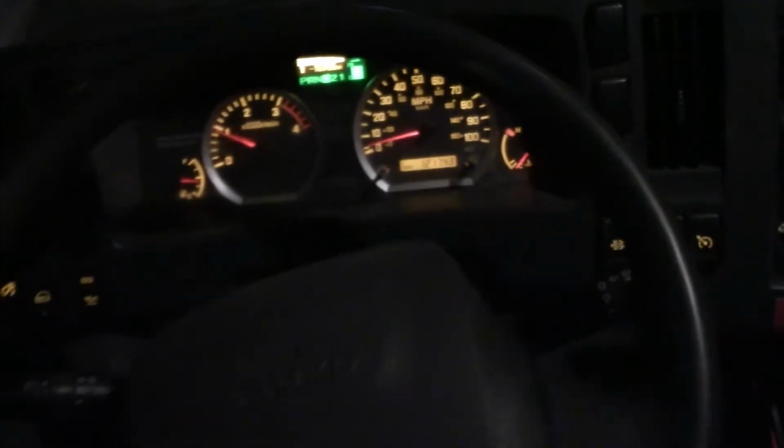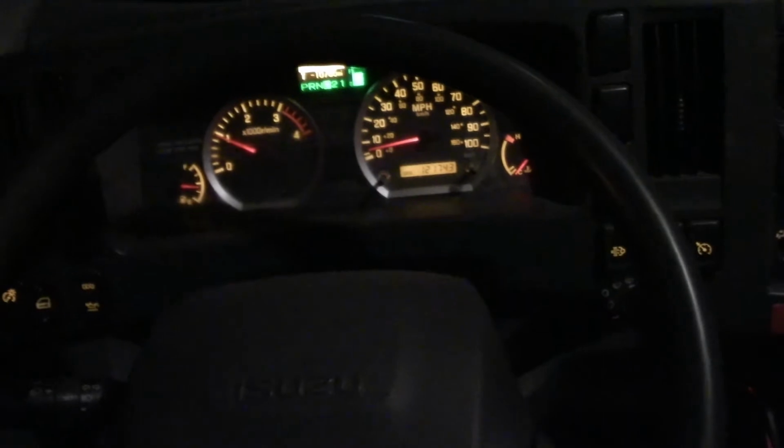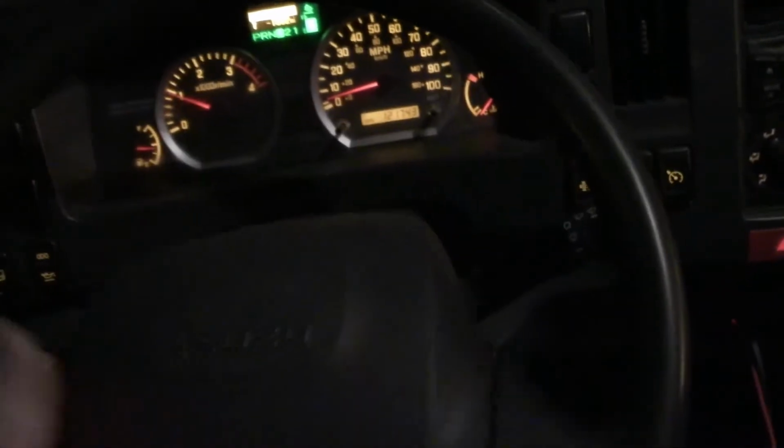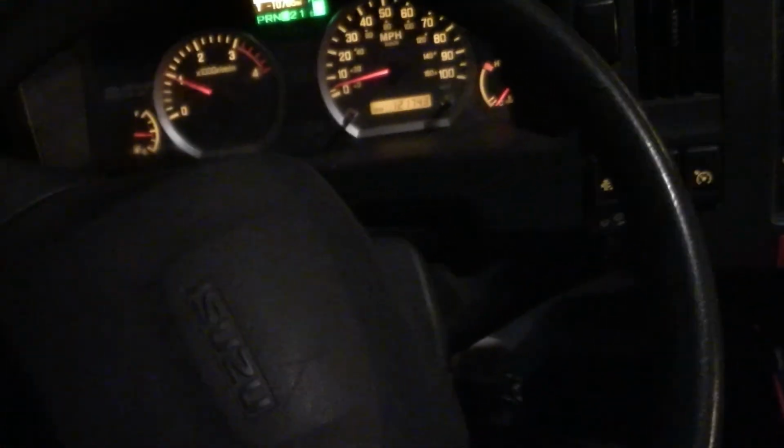So I just made a right hand turn, I let go of the wheel, and it's still staying in that right hand turn position. I'm having to bring it back to center manually. So there is something wrong with the steering. Most likely this is some sort of binding in the kingpins. Here, I'm doing it again. So we'll take a look at that.